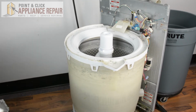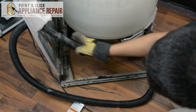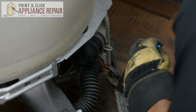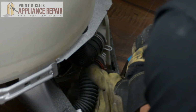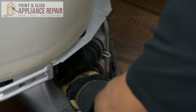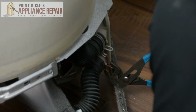So our drain hose assembly is going to include this hose that runs into this piece right here, and this hose as well that connects all the way up here. So what I'm going to do first is I'm going to take my channel locks, and I'm going to grab onto this clamp, and I'm going to release the hose. Once I've got it loose, I'm just going to wiggle the hose free. Move that clamp on the back there.